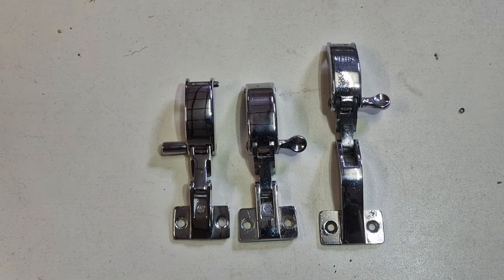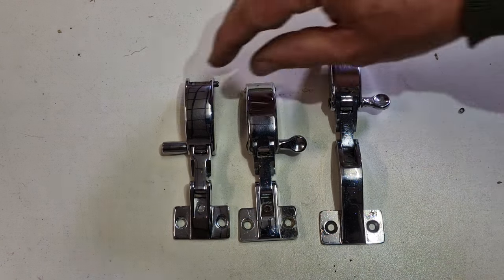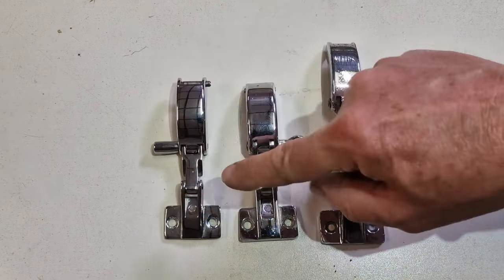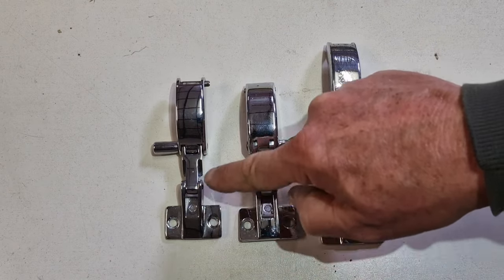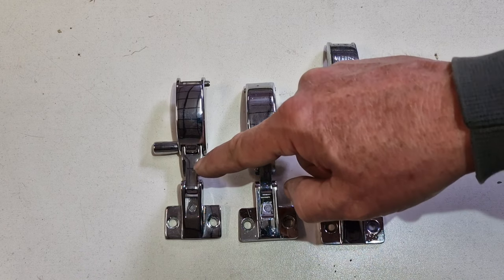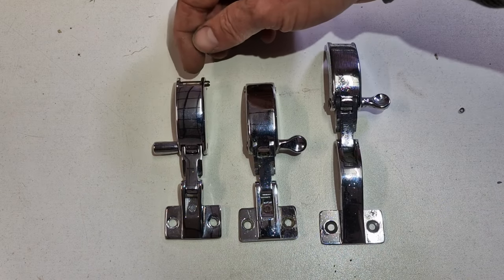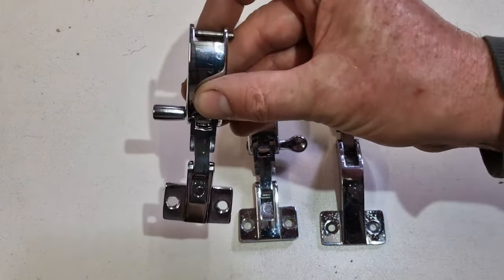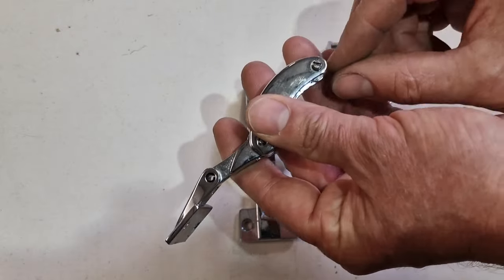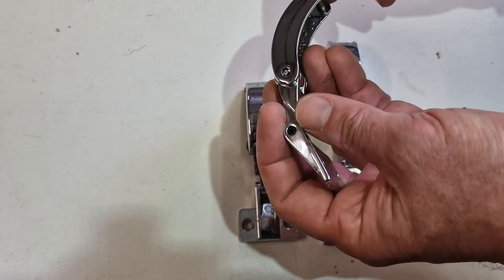And here we have the quarter light catches on the fixed head coupe. You might think they're all the same, but they are not. Here you see, this is the second version only. There's another version before this, which has a longer leg, because of the construction, and then they found out that it didn't hold, because the mounting for this on the window was in driving direction, so the first cars needed to be a bit longer to reach that angle here.